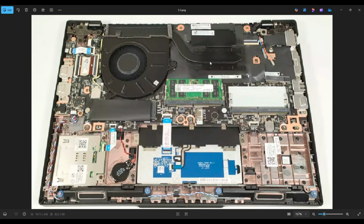But one of the things it'll show you, in addition to how to clean out your fan and your vent, is how to clean off all the old thermal paste from both the heatsink and the CPU area. You don't want to put new paste on top of old paste. And then it will also show you how to apply the correct amount of thermal paste. If you put too much down, you end up locking heat in rather than facilitating its transport out. So if you need help with that operation, I will have that below in the description.